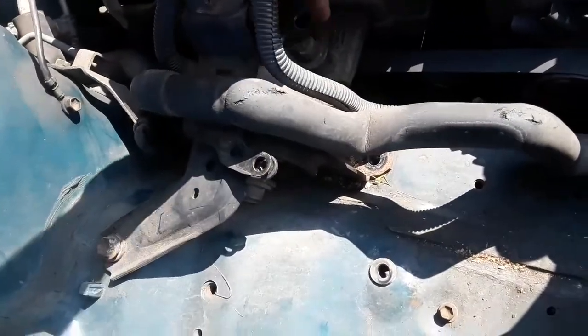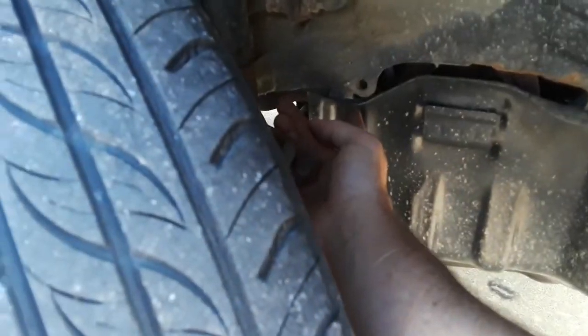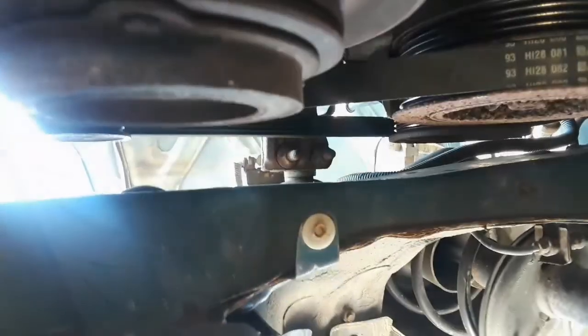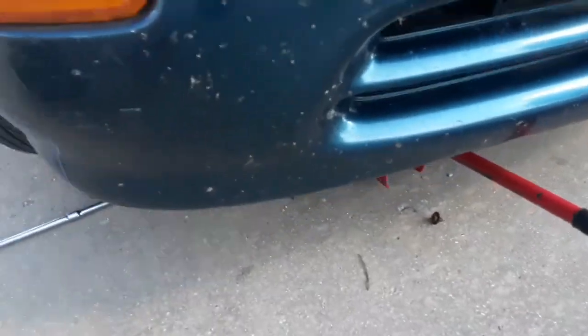These two right here from down there — you have to do them from underneath. So the best thing to do is come up underneath your passenger side and you will see right here — those are 10 millimeter bolts right there that secure these two. This panel just drops right down and you can access them that way. From right here you can see those two bolts. That's gonna help alleviate the entire problem. They're deep sockets, 14 — put some tension on that and take it loose.